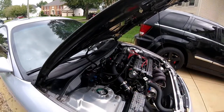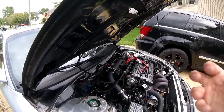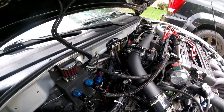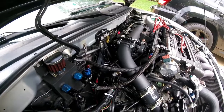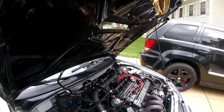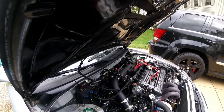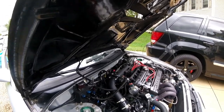I went ahead and tried to plug it in and noticed a couple weeks ago that my connector looked really burnt up and like it was falling apart. So I ordered a pigtail from Ohm Racing - they supply all the OEM Mitsubishi, Evo, and DSM connectors, so you can go ahead and purchase those from them. I wired it in, started the car up, free revved it, wasn't getting any more phantom knock, put a little more oil in it from when I changed out the line, dropped it on the ground, and just went down and started boosting. The car pulled hard.